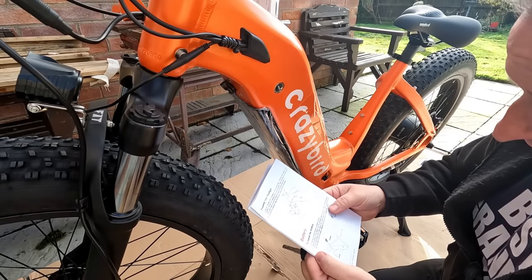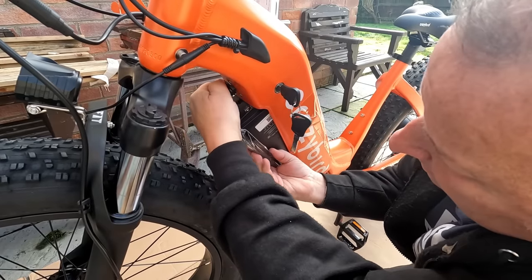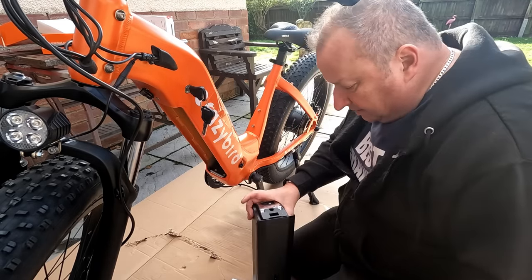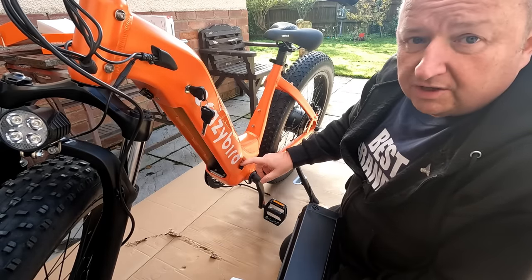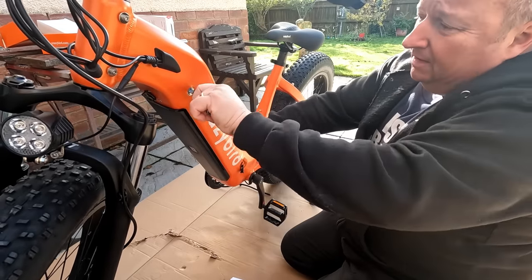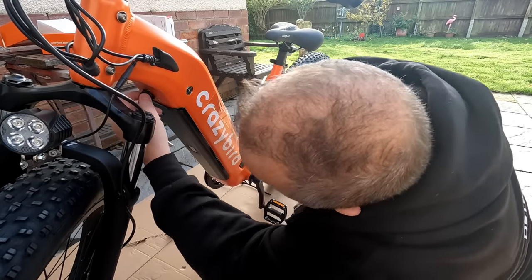The battery's already in there. It says turn the key clockwise to release the lock — so put it in there anti-clockwise. There's a little lock up here, then seat it down and push that. That's the battery — that's how you take it out. It's quite a weighty thing. Don't forget, you don't need to take the battery out to charge this at all. Press there to see if the battery is charged — there's a little indicator light. The charging point is on the bottom, so you can plug the charger directly into this with the battery in the bike. Putting it back in is literally getting it bottom-seated first and then pushing it back in. Turn the key clockwise. You can charge it up through this port down here. I'll put that rubber plug in. The battery has got charging. That's the removing the battery lever up there.